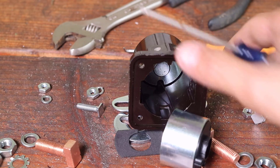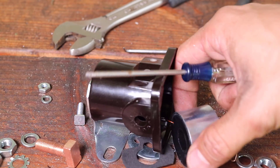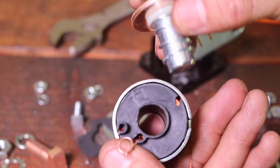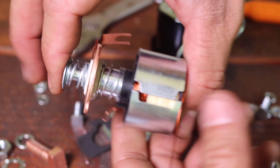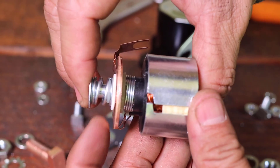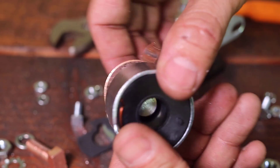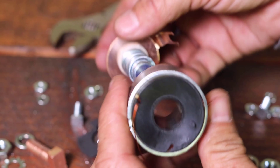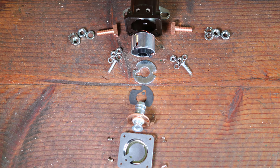It is again what allows the solenoid coil to be grounded through the chassis rather than to have an additional ground wire. By squeezing the momentary switch with the springs, we can see the motion that happens when the solenoid coil becomes an electromagnet — it attracts the momentary switch upward into position. Although this video and content is very similar to the five-pole starter solenoid video, I still wanted to include it because the four-pole may be more common. I also wanted to show exactly what was different from the inside view.